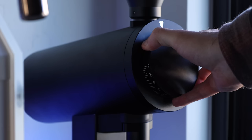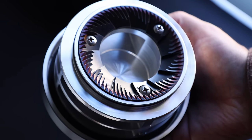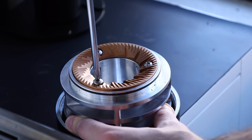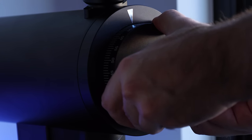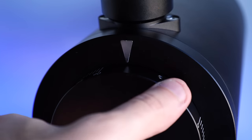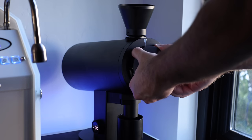Considering the 83V has two burr options, I checked alignment with both sets and found that — at least on this unit — the burrs are very well aligned, requiring no adjustments or shims even after swapping back and forth. The swap itself is very simple, taking just a few minutes. And since they've come to terms with users wanting a variety of burr options, they've designed the grind setting knob to have an adjustable zero. Once new burrs are in, slowly adjust finer until they begin to chirp, slightly back off, then turn off the grinder. Loosen the dial with the included Allen wrench, adjust to just before the chirping point, tighten back down, give it a quick test, and you're set with a new zero — a small but meaningful addition that surprisingly not a lot of grinders have.